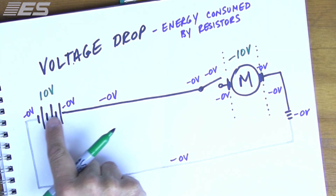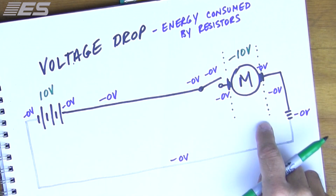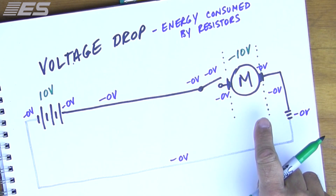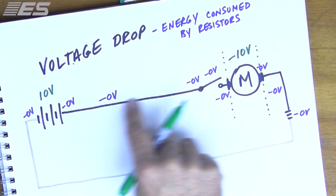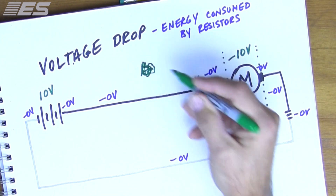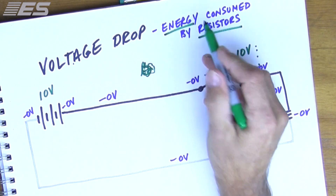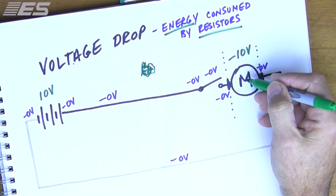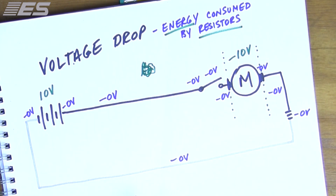The connections are what are going to kill you. It ain't going to be the battery, and it ain't going to be the starter. It might be the contacts, maybe, maybe not — we can always test them. But all of these connections, anywhere somebody may have poked a hole in a wire, anywhere there's corrosion — green crap — that stuff is going to create a resistor. That resistor gets hot. That heat is energy stolen by corrosion that cannot be used by the motor, so the motor runs badly. You never, ever want to pull the starter if you know you have a cable problem — which is the whole point of the Starter Buddy.